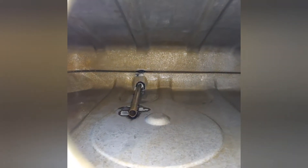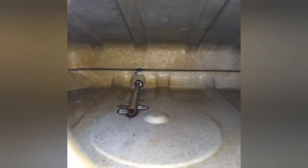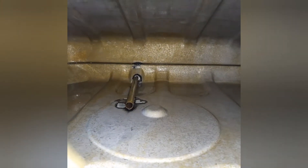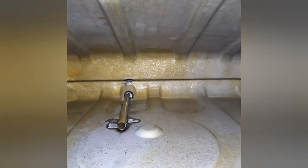That surface rust I'm not too concerned about because it comes off easily now that I've got the worst of it off. If I gave it a quick rinse with acid there was stuff literally rinsing off before your eyes - it's amazing. I have purchased some POR-15 tank sealant and metal prep which I'll pick up this week, so I will be coating the inside of the tank with that. You can see the breather pipe just poking through the back there.